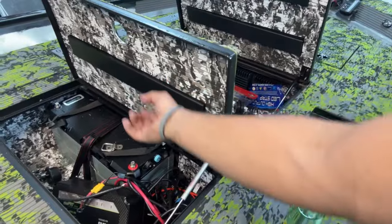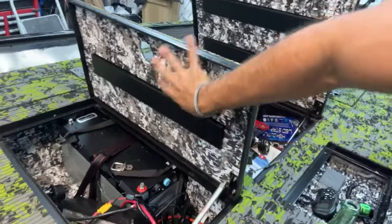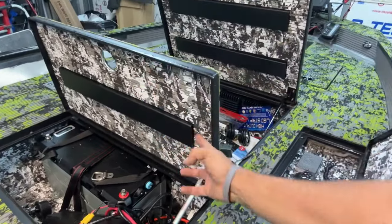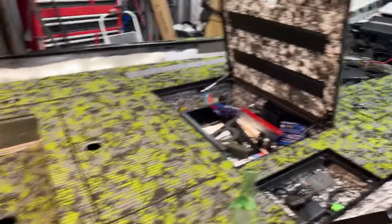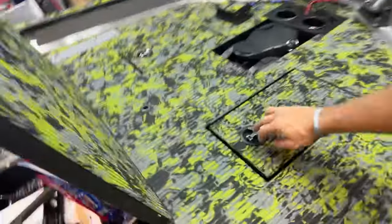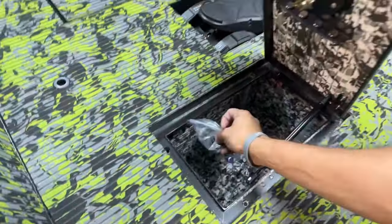A lot of people foam the compartments but not the lid — that's like peanut butter without the jelly. You should foam the whole thing, because double-foaming from the top and the bottom gives an extra layer of insulation. You can really feel the difference — the bare metal support bar is hot to the touch, but the foamed surfaces aren't. It truly matters.